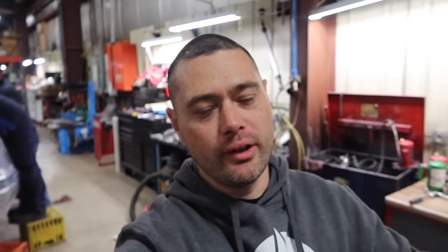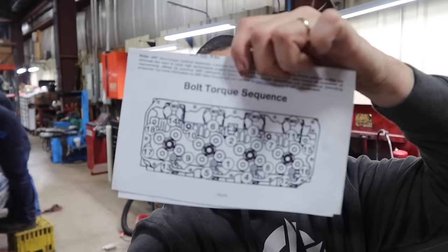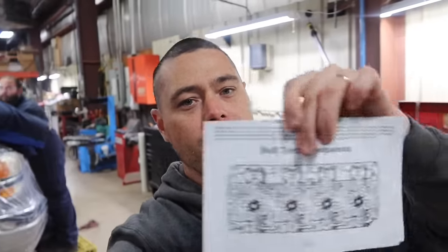It's kind of tedious to go over every single bolt and show. So you guys see it right there? That's exactly what he's looking at. He's going through his second round right now. Once he's done, he's going to hit it back up within the same sequence at 125 foot-pounds. So he's going to continue to plug away on that.